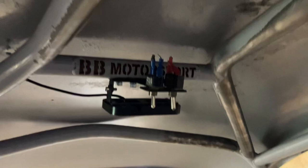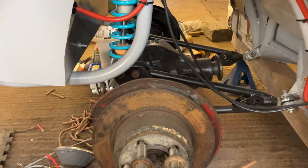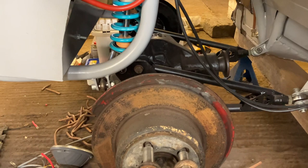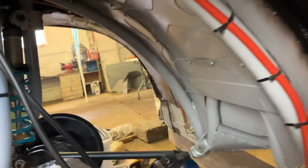Let's come around to the back axle. This is a Volvo 240 back axle running — I think it's a 790 limited slip that I managed to find and fit. We fully rebuilt that about two years ago when it was running the Rover, just because it's the right thing to do. These arms I already had — Bennett Built modified them slightly, strengthened them up, and ran the rose joints. You can see how they've done the chassis underneath where it folds up and rolls behind it — a nice U-shape — and there's another pair of Nitrons.